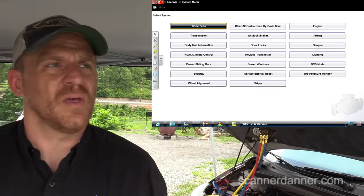So — clutch — what can we do? Let's talk about the options. One: we could put an amp clamp in a loop between the load side pins of this relay and measure current flow to the clutch itself. If we have current flow going to the clutch, we don't really need to check our powers and grounds. From doing these in the past, I'd expect around 1 to 4 amps for the clutch running. So we could do that test.